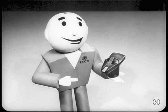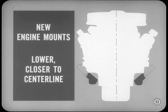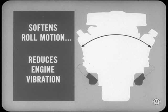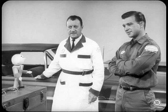From now on, this wide-blade distributor rotor will be the only type supplied for sixes and eights — no more narrow blade rotors. There's also an engine mount change affecting all eight-cylinder models except compacts and Imperials. The new 45-degree shear type front engine mounts are located lower and closer to the center line of the engine. Bringing the engine mounts closer together tends to soften the roll or lateral rocking motion, reducing the amount of engine vibration transmitted to the passenger compartment at idle speed. The new mounts are also tuned to absorb objectionable suspension vibrations, so they absorb both engine and suspension vibrations.